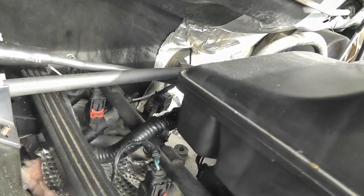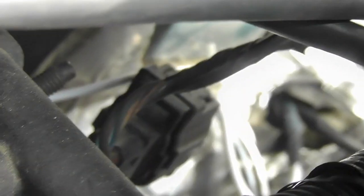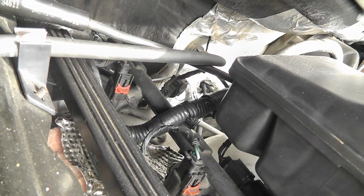Terminal 86 I've wired along the rear of the engine compartment on that back harness, and it goes through a hole in the firewall right back there to the switch inside the dash that I've mounted — I'll show you that.